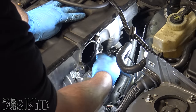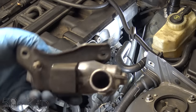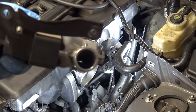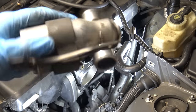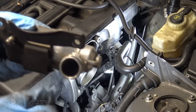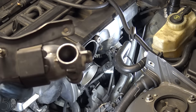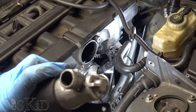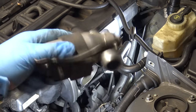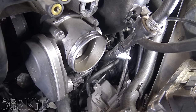All you've got to do with the idle air control valve is wiggle it out. You should be able to hear a little noise, and if you look in there you should see a little flap inside flapping up and down. If it's not flapping freely, depending on the age of your car, it's going to be gunked up. Spray it with WD-40 — that'll both clean it and lubricate it. Make sure it's nice and clean and flapping free.